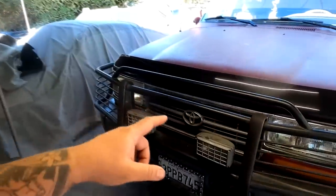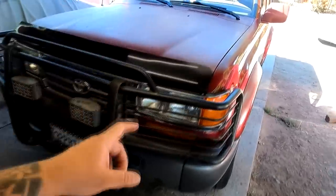But before we get to my brother's car, I'm gonna be working on my uncle's Land Cruiser again. You guys remember we did the radiator swap, which I have right there. Mongo's been driving the Land Cruiser for the last 3 days. And when he got off of work yesterday, he went to his truck and realized there was a pool of ATF on the floor. So I drove all the way out there to figure out what was going on. And I realized that one of the hoses for the trans oil to the radiator was pinched and ripped.